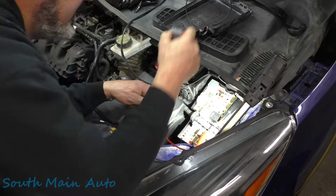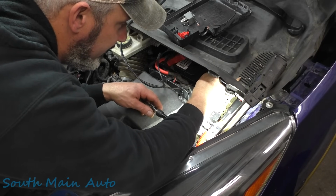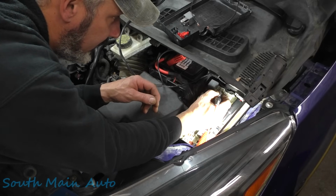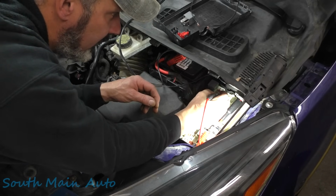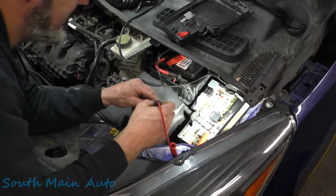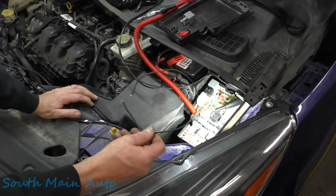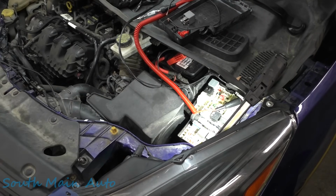this ignition on relay. So I got a relay bypass here. We're just gonna bypass it so we can still use our test light. Okay, now all these little guys are alive again. So that livens up the fuse box, essentially what he was doing by shoving that piece of wire in there. So let's just go like this real quick.